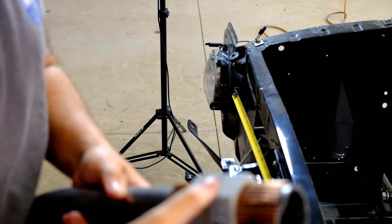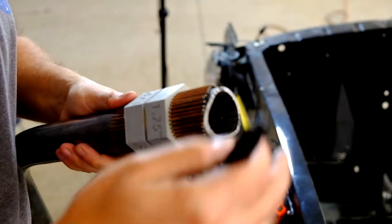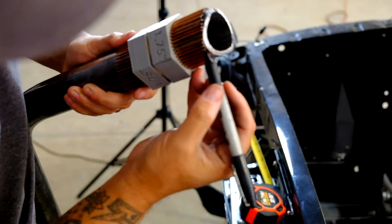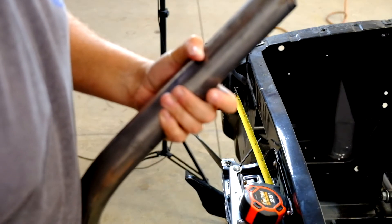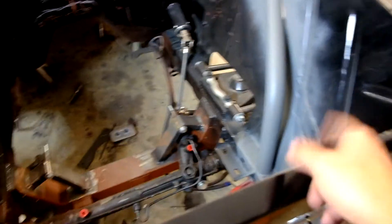I've got the lines lined up and the outline transferred onto my pipe. I brought it back far enough that I can get good purchase all the way around, then just follow the contour there. Just like that — now you've got your contour transferred onto your tube. Both sides are in, bent and mocked up. I'm going to do one more final measurement from the inside of the radius to the frame rail to make sure it matches the other side.